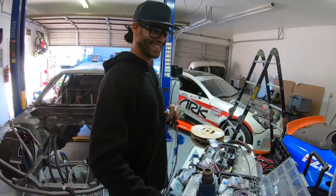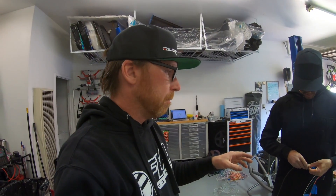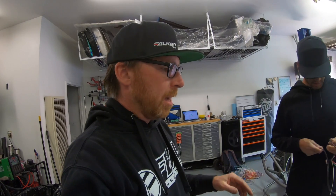We've got two 20-amp outputs available. The fuel pump might get near 20 amps, and when the wire gets hot and it's kind of long it can build resistance and hit close to maxing out that 20-amp output. So we're going to take two 20-amp outputs — giving us a potential of 40 amps — and the PDMs from Race Pack allow us to do that.